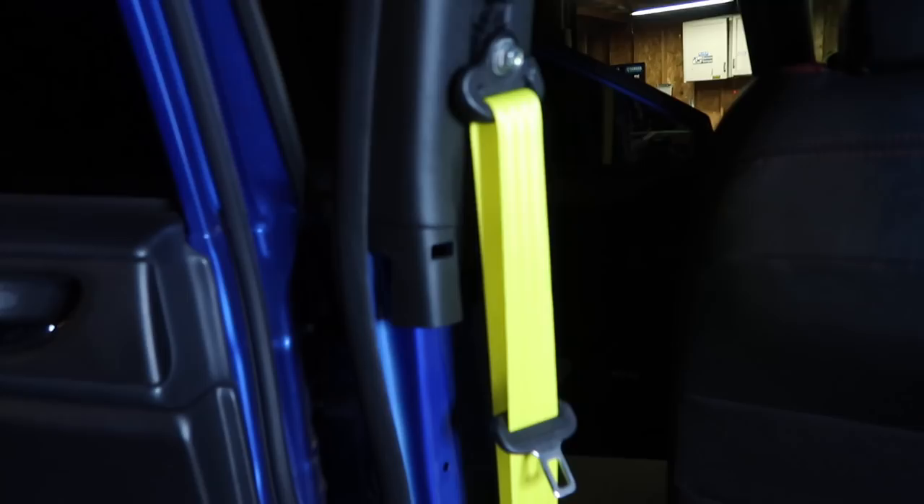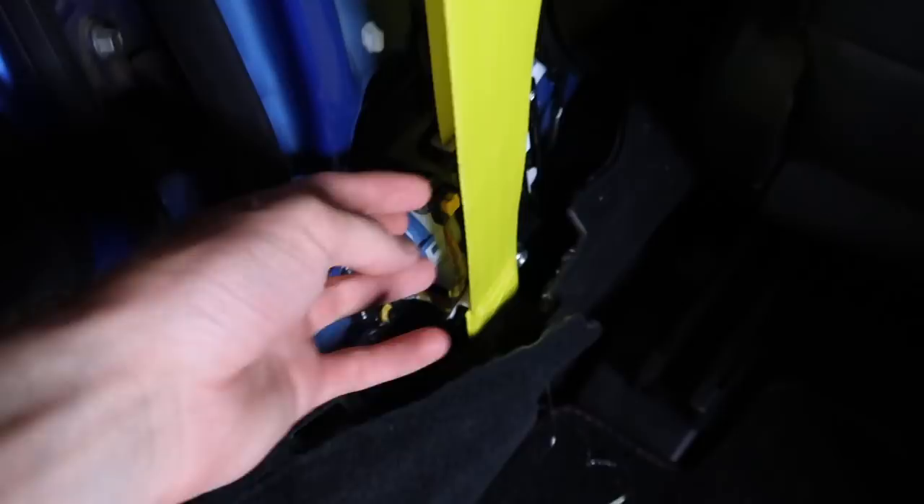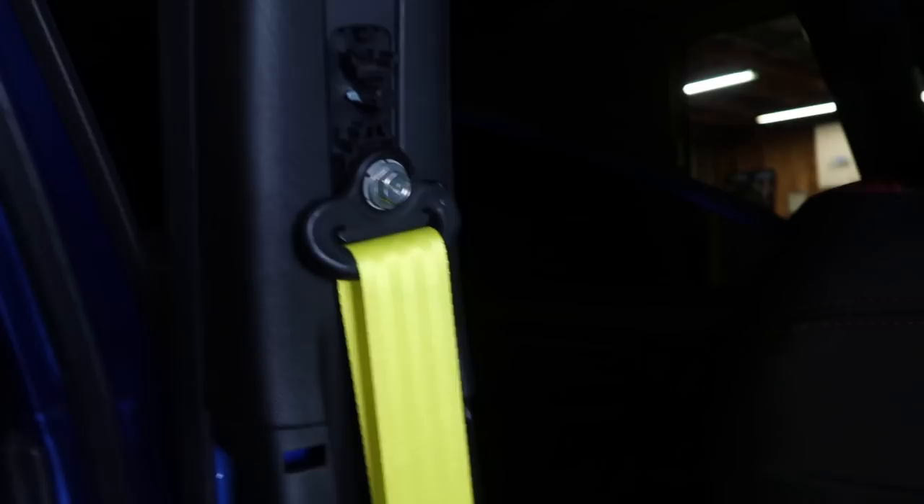Install in progress — it's looking good. The driver's side is really simple. One important thing you need to know that freaked me out: the seat belt mechanism has to be completely upright, just like it sits in the car, for the seat belt to retract and come back up. I was having a problem where I couldn't pull it up far enough to hook it back. Once it's sitting upright it'll snap for a second, then loosen, and you can drag it up and pop it in. It's basically just bolted down, hook the electronics back up, and the driver's side is done.